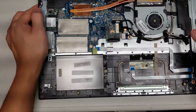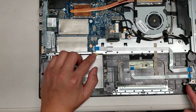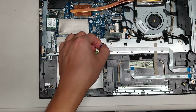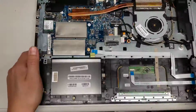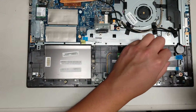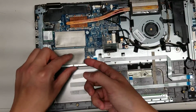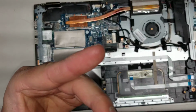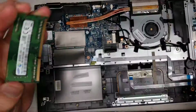Okay. And you got this connector here for this trackpad, and then it looks like LEDs. Alright, so we're going to have to set that aside. Let's see, hopefully I can leave the cable on there when I take this out, looks like. So I'll undo this one as well. Okay, just like that. The RAM is under here. I'm going to leave those in, but I'll show you what type of RAM. So this uses DDR3 12800S. Okay, PC3 12800S. So that's the RAM you need.